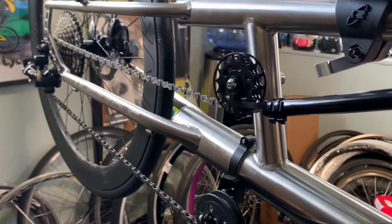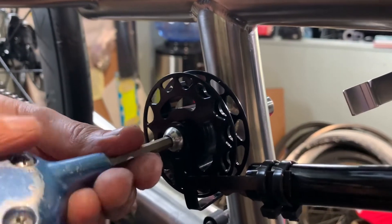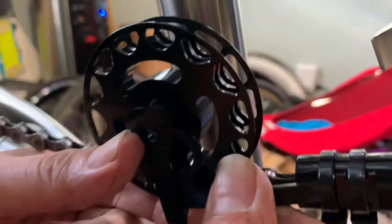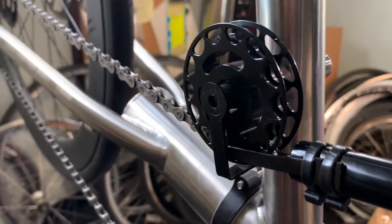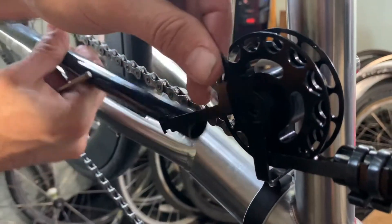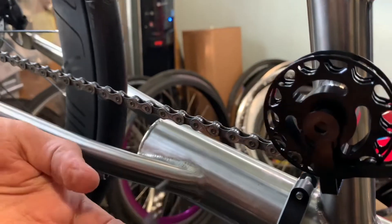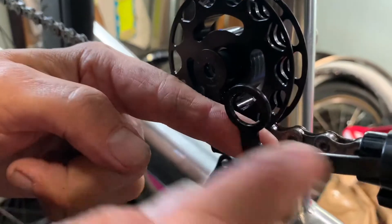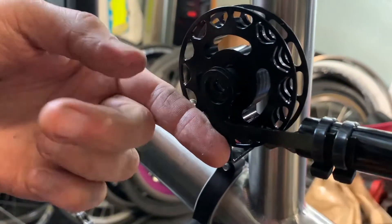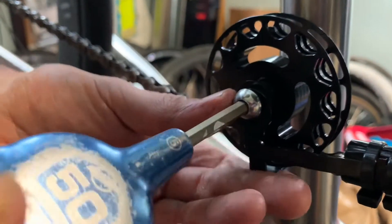When you ship this bike, the tube will be up inside here, with another one pointing the other direction, zip-tied in place. You're going to pull the back one all the way off — you don't need it based on our testing. Then take the remaining tube, which is zip-tied, and put it on the very outside so it doesn't scrape against the idler. Then retighten and align it.